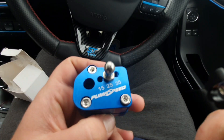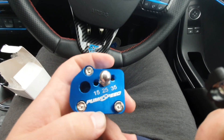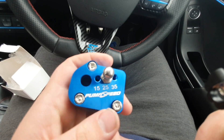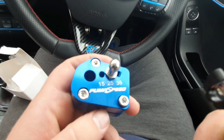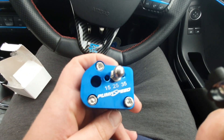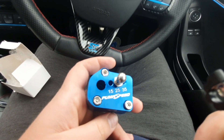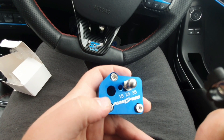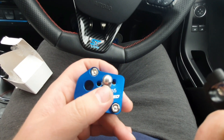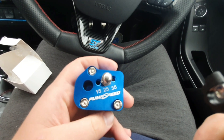To get this on, you'll have to take these cap heads out, disconnect the linkage with a screwdriver, then fit the new piece on. The linkage goes into this hole, and then you put the linkage back on afterwards.